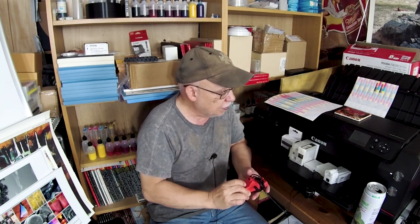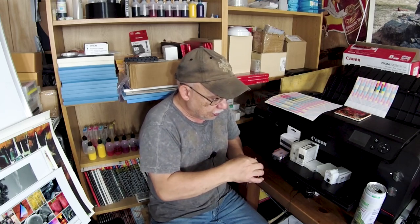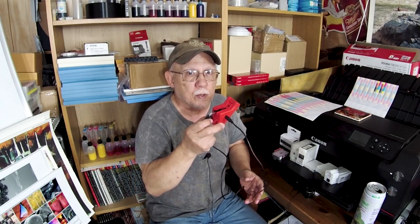This is a resetter for a Pro 10. This Pro 10 cartridge right here is full, so I cannot demonstrate how to reset it. You plug this into your USB power source. This is critical because most of these resetters from across the ocean can come with a CR2032 round battery — those little disk batteries — and who knows how long they sat in a warehouse. So by the time you get them, that battery may not deliver full voltage and your resetting may be faulty, and if that happens it could damage that chip.